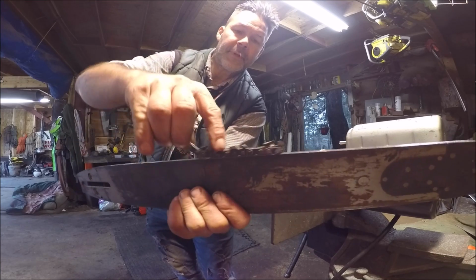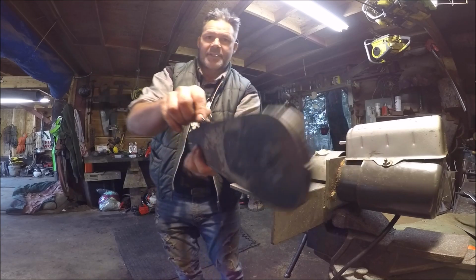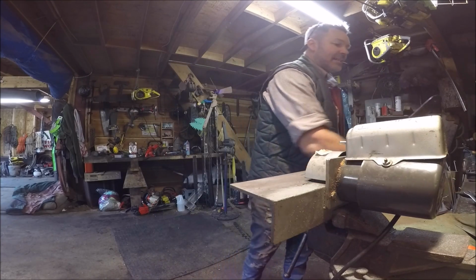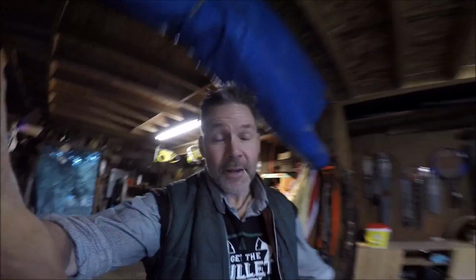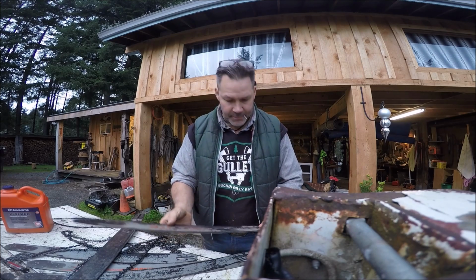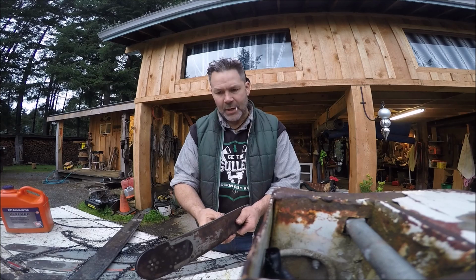Okay, friends? That's bar maintenance. Does that make sense, friends? I'll bet it does, doesn't it? As far as bar maintenance goes, that is bar maintenance. It's grinding your bars, or dressing. People call it dressing. Do whatever you want to call it, but do it. This bar's ready for service again.